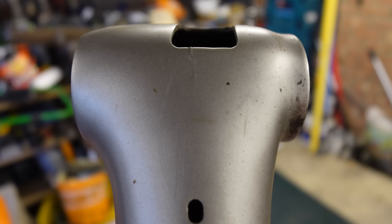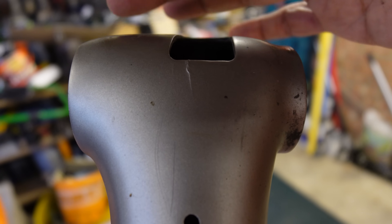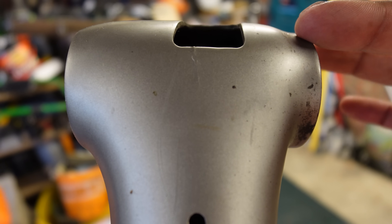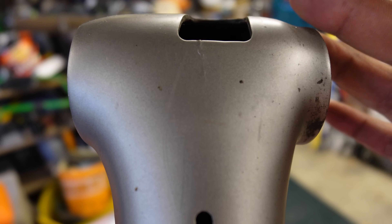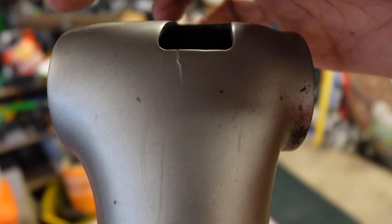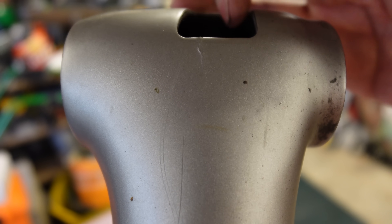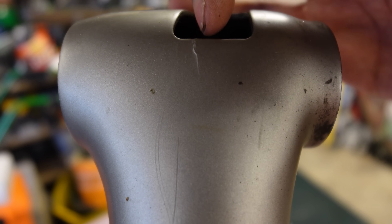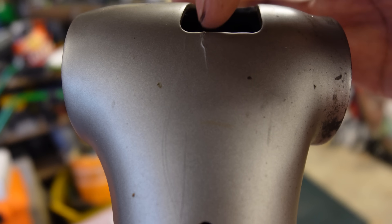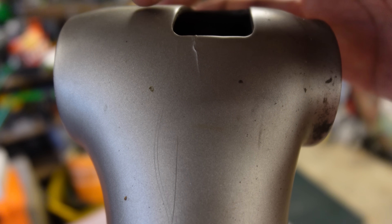The crack is not the failure mode — the crack is the symptom. I believe it's been caused by the undersized side of the bike frame. We've got one side that's undersized and one that's oversized. When you press the bottom bracket in, the oversized side clamps up flat with no resistance, but the undersized side — being so heavily undersized — starts to develop significant stress. Where there's no material, which is where the gear cable guide goes, stress builds up and it always fails at a joint. That's what's caused it. This bottom bracket is heavily undersized at the pinch point.